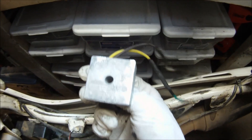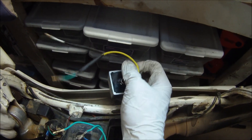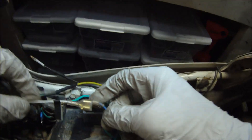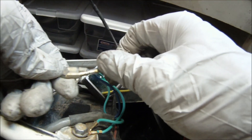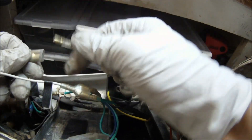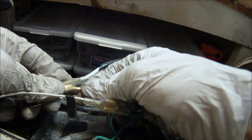Here we have a 100-watt AC regulator. I will use 100 watts from the stator to power the lights on the XR. To ensure no unnecessary extra power flows through the system, I will hook the power wire from the stator — which is the white wire — to the Baja Designs blue wire that goes to the headlight and to the AC regulator. I will then hook the green wire from the stator to the other side of the AC regulator and go to a ground wire hooked onto the frame.